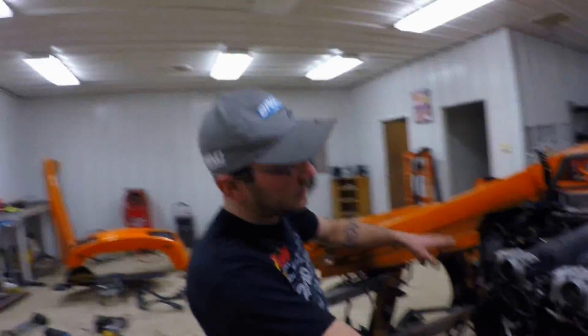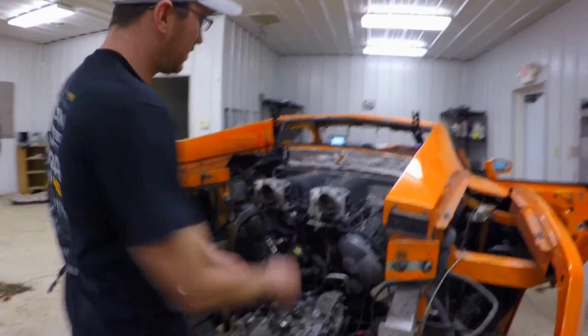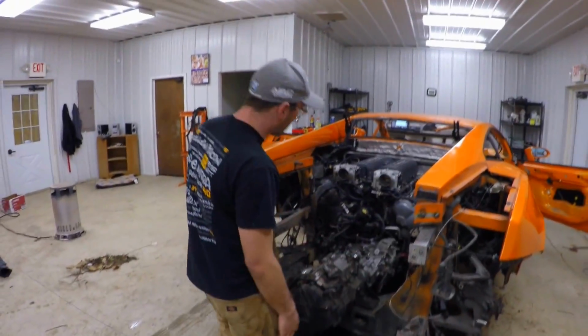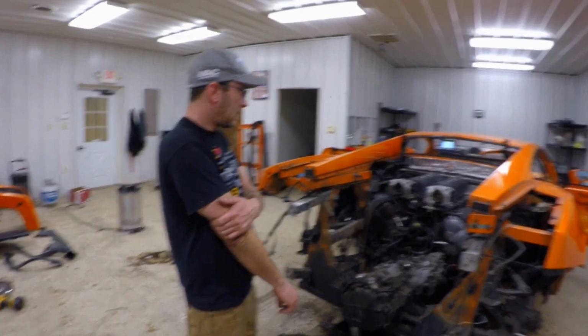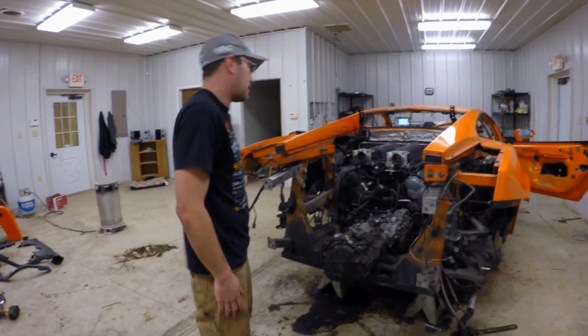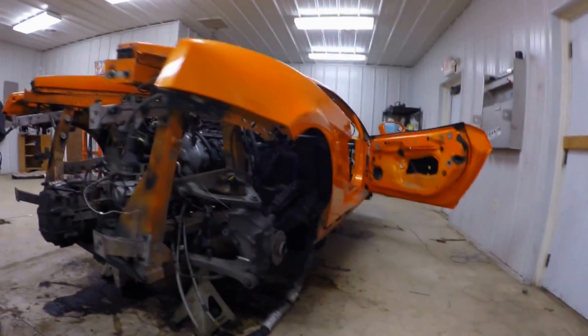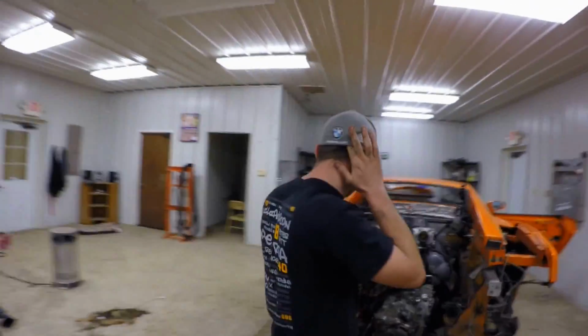Everything on the motor of this car, you've got 2 fuel tanks, 2 fuel pumps, 2 separate intake manifolds. This one feeds this bank of cylinders, this one feeds this bank. And it's all wired and run as essentially 2 separate engines. Wow. So the ECU just manages it. Yeah, but it's all separate the way they have it in the car. That's awesome. It's easier, I guess, to diagnose at that point, left bank versus right bank issues.